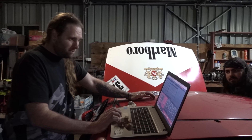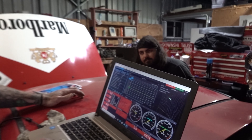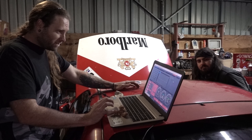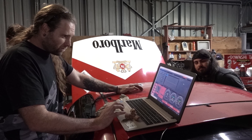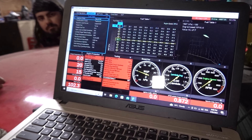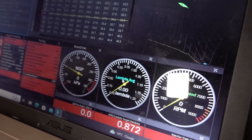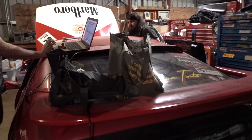So what were you doing Benjamin? Just setting all the parameters up to hopefully be able to do a bit of basic tuning and have the car cycle all the fans and everything it needs to run as a car. We've set the auxiliary outputs for the fans and just wired the lambda in — but we're not sure on the configuration of that. I use a little Haltech not Link, so we're having a bit of a play around trying to get it all set up.